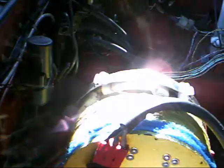The centrifugal torque converter idea seems to be there, but the implementation has issues. To run the car we need at least 150 foot-pounds of torque, if not 200. In testing, we're shredding the plastic off the little fingers so they're not going into the slots far enough.